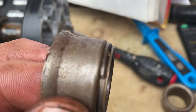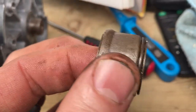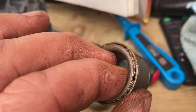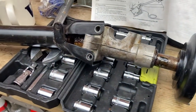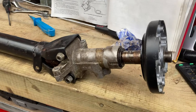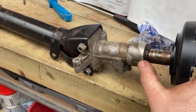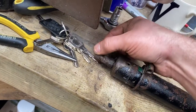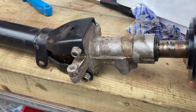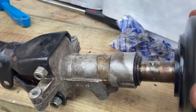Is that right? Is there any point in me doing this if these are the new kind of bearings you get? I'm wondering now whether it wasn't bearings at all, because when I wiggle this, that bearing doesn't move. This bearing doesn't move either. I'm wondering whether it was these bolts here not being tight enough that was giving the wiggle.